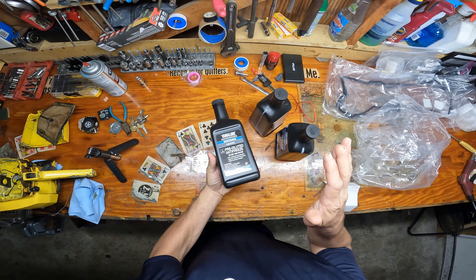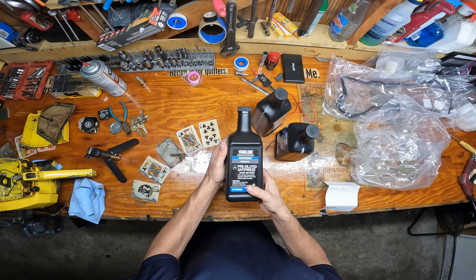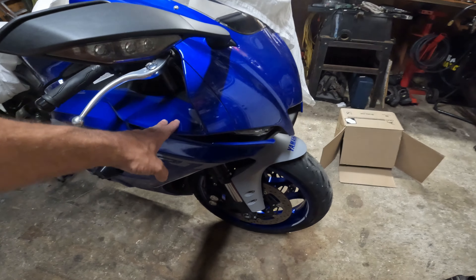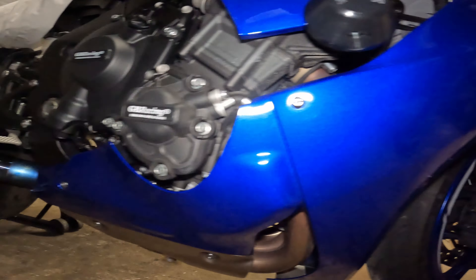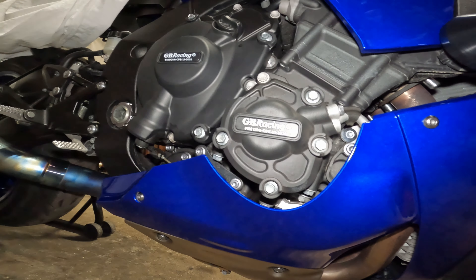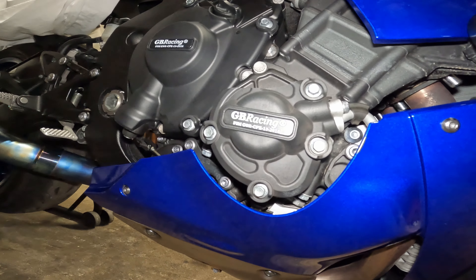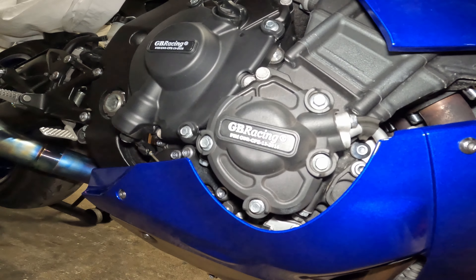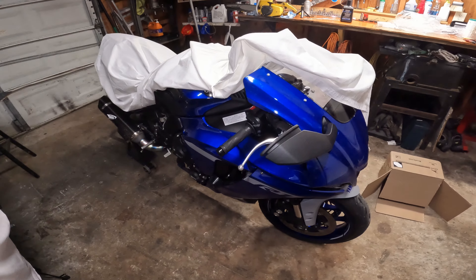The book suggests a one-to-one ratio. The only ones I can find from Yamaha are 60/40, so we're going to have to remove this upper fairing and this side panel to be able to get to the antifreeze. When we remove this piece it'll expose the water pump where the drain bolt is. There's actually a drain plug and a vent plug — that vent plug comes into play when you're bleeding the system. That's why I got two gaskets; you may not need the second one but I like to be safe rather than sorry.